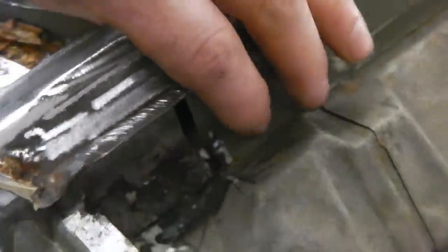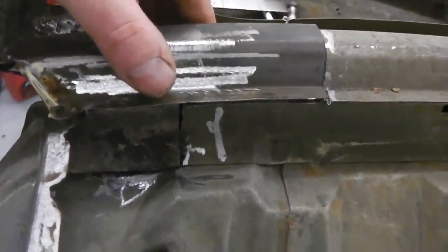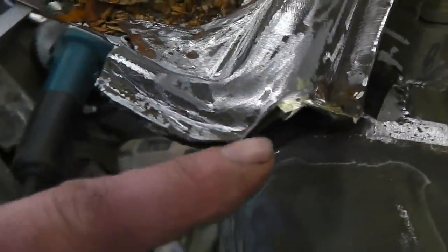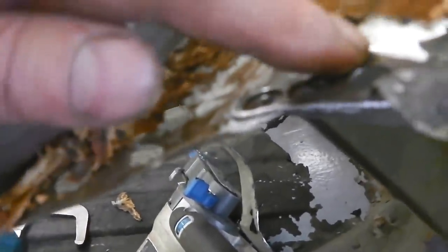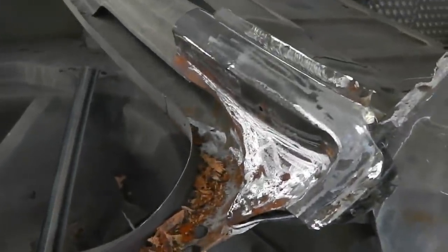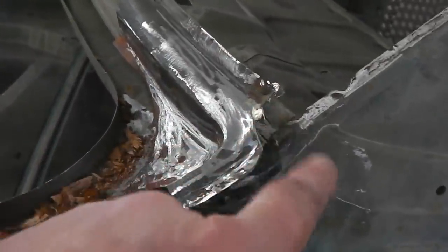If we just slot in, I'll take you up and over so you can see better. You can see how we're fitting now, look, to make a nice seamless repair there. It's very important to get this distance correct because the wing needs to come in there, so we make sure that we land exactly where the old one came off. So we're going to scribe this with a scratch line. We're not going to use the silver paint because I'm about to crock sand this off here. So we could do a scribe and a scratch line in it so that this lands exactly in the same place, and by doing that we know not only that the window aperture is right, but the wing's going to land on its receiving tab here and on its braze point there.